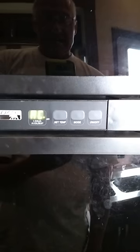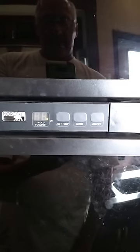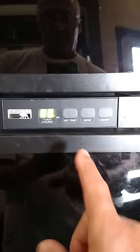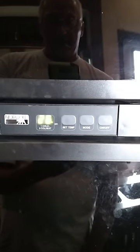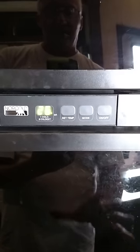Did it fix anything? Let's look at that temperature again. Wait until that display goes out — don't do anything until that goes away and you're back to a dot. Hold these both down again. There's your number one — let go. 88 shows up. The temperature of those fins is on screen number three. I'm going to go until I get to number three, and there's 26 degrees. That's what I do to clear any kind of error codes to see if I can get this thing to start cooling again.